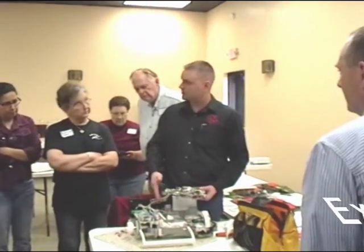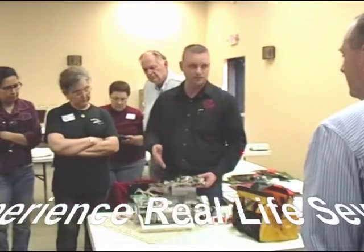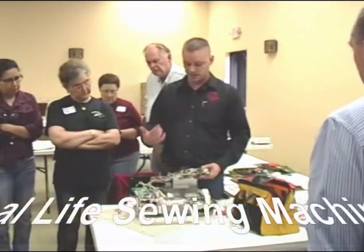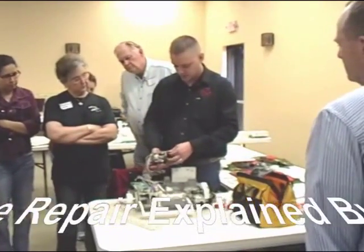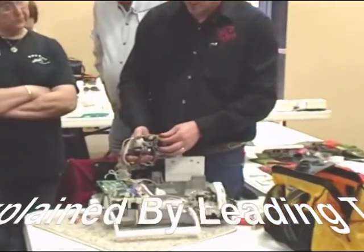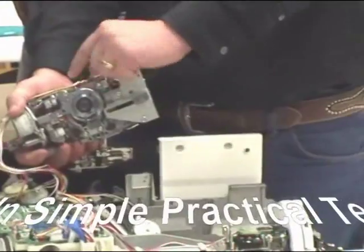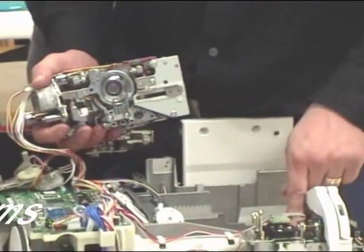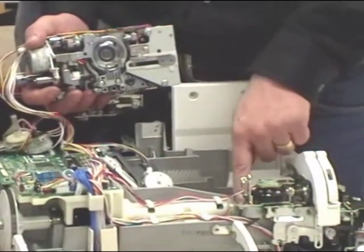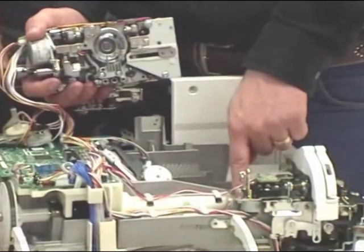If I adjust the timing belt, what do I adjust? Feed dog timing and everything else. So the secret on this machine is that if we're looking at the hook assembly, there should be a dot right here. This dot right here in the hook has a timing mark right there. The dot should face forward towards you. Then the stroke crank at the top has a large screw right here. That should face you also. Once you put it in, they should line up perfect.